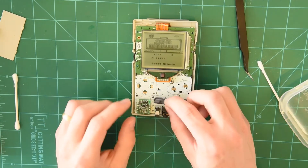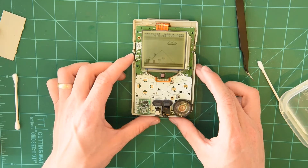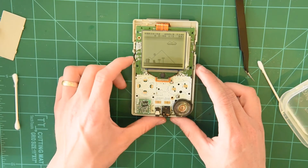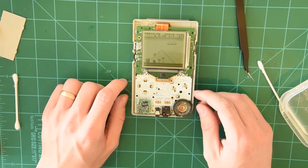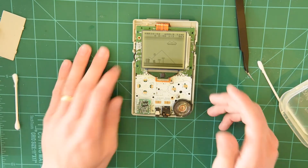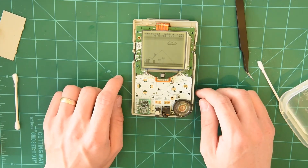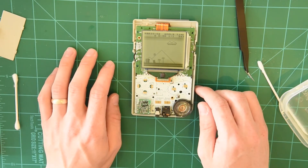You can see on the display the sound's working — it's a little crunchy but yeah, another Game Boy has been revived. So this has been our troubleshooting and quick repairs — the battery terminal corrosion and the dirt in the power switch. Those are the two most common problems, and as you saw, it's one or the other most of the time. These are both really quick home remedies you can do for your Game Boy. In the next video I'm going to go through top to bottom how we can clean every part of the Game Boy and make it look beautiful again. Thanks for watching.